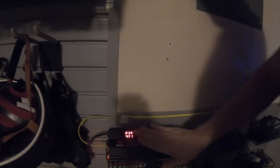That's the eWheels charger version 3 or version 4, whichever one has the reset button on it most recently. It's quite warm to the touch. I've used this charger quite a bit already on my M10 and on the M Super 84 volt. So they're all 4-pin. I've gotten a lot of use out of this charger, really. There it is, it's ramping down, 4.8. 4.9, so we're getting there as it's balancing out the cells.